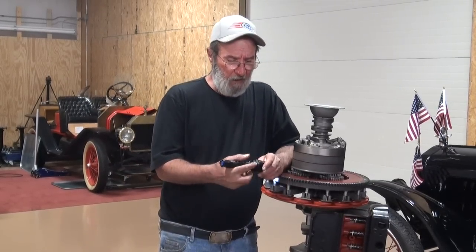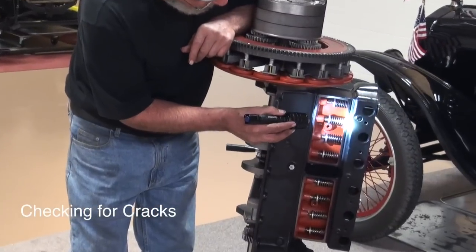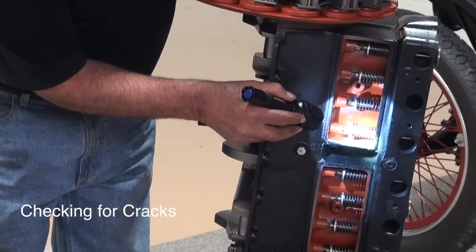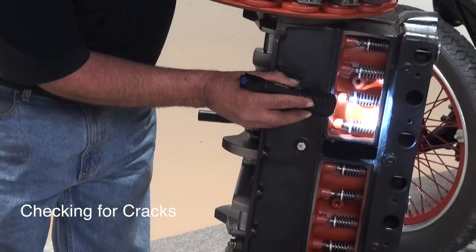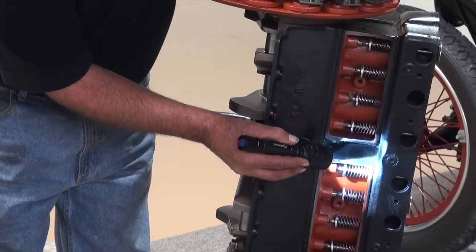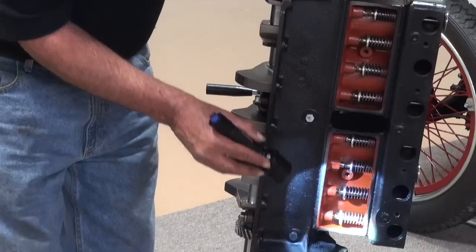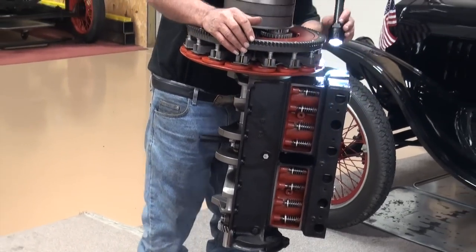A couple of areas I really want to look at — I'll use the flashlight — is the block prior to any kind of cleaning on it. I like to look at the water jacket. Typically if you've got any breaks or cracks from where it's froze up, it'll be in this area. I do not find it to be the case with a double door valve cover, but on the single valve covers I've even seen cracks inside the valve galley. You want to take a look — generally if it's a crack you can see it. Some people go to the extent of cleaning the block and having it magnafluxed. All of the water jacket on both sides of the engine you would want to examine.